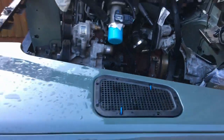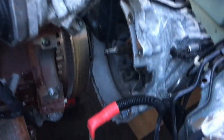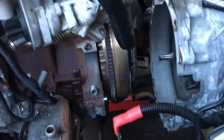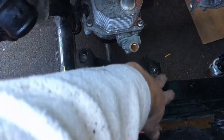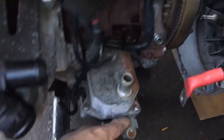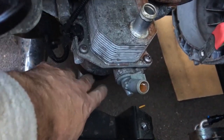Here we go - it's lifted up and out. I've got a rag on top of the engine to protect the plastic cover. You can see everything is lovely and clean in the bellhousing - only to be expected after 16,000 miles but she is nine years old. On that bracket supporting the ECU we've got more rust - interesting that nothing painted green has rusted but everything painted black has. We can see a massive dual mass flywheel and a clutch on the back, which is one of the reasons I took the engine out. I've removed the engine mounts - the elbow there is plastic, one bang and it'll be gone.